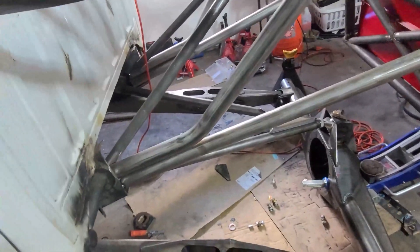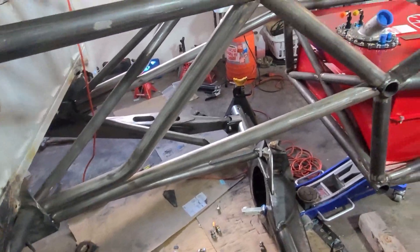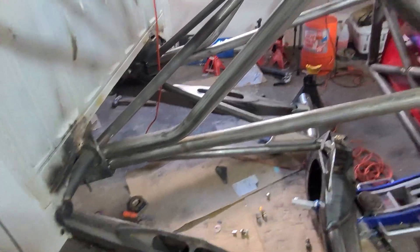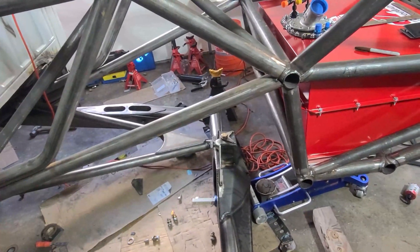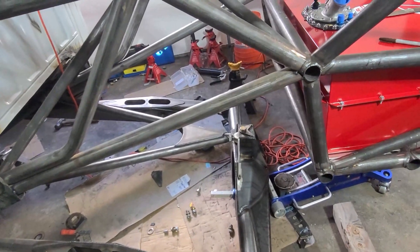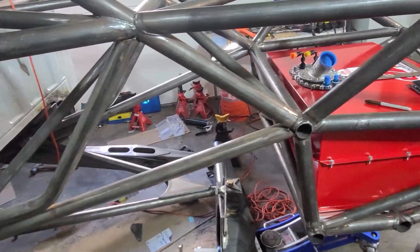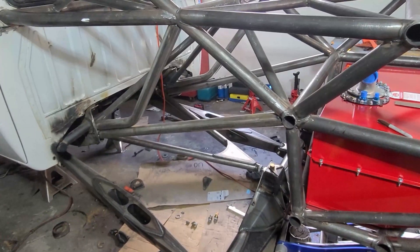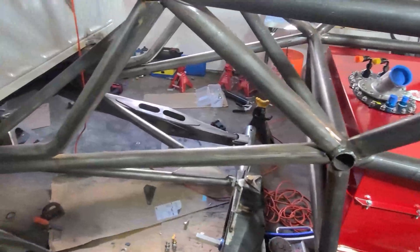There's about two inches of stroke left in the shocks, and I estimate about a 50 percent motion ratio — could be a little less or more. That two inches of shock shaft translates to four inches of wheel travel, putting us in the 30s. That won't be strapped at 30, so you'll want to take a few inches out for safety and bump stops. I'd say this kit will probably be strapped at around 26 inches of travel, which is plenty — and while it's not a trophy truck, those are still big numbers when you're talking about feet of travel.